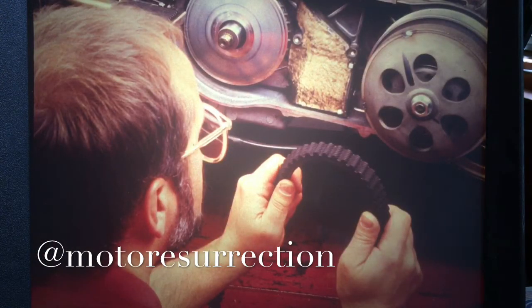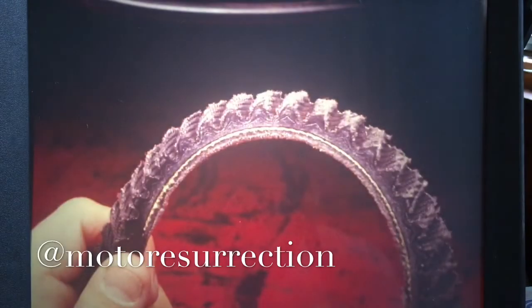Examine the belt closely for signs of cracking, separation, and abnormal or excessive wear, or thin spots like this one. Prolonged slippage usually causes this, such as when a rider uses the engine instead of the brake to keep the scooter from rolling backward on a hill, or by giving the engine throttle with the brakes applied. If the belt shows signs of excessive wear or damage, replace it.